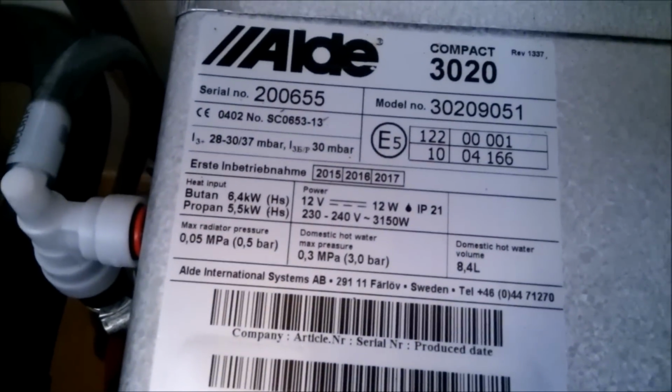No, that's fine. There's the pump at the bottom, the blue one. It's got a dial on the front. You can alter the speed settings. It's normally about 2, but we set it to maximum, which is around about 5 now, to get the flow through. Oh, there's a gurgle of air I just heard. That's the air going through.